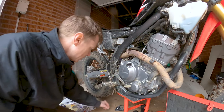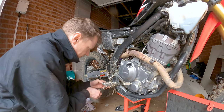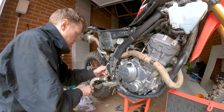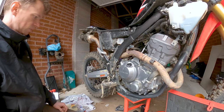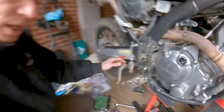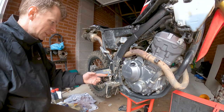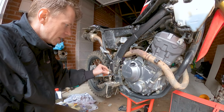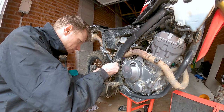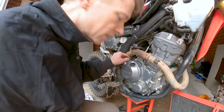There we go — what we call a nappy pin. One final spring down here, the return spring — off the back it pops. Now if you wanted to do it differently you could remove the split pin, but I don't have a replacement and I don't want to damage it, so that's just a little fix. Now we're going to disconnect the clutch cable — it's the same style as on a mountain bike brake. Just push it in a fraction and slip the clutch cable out.